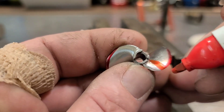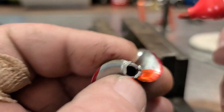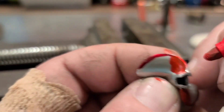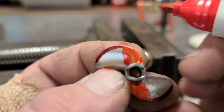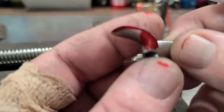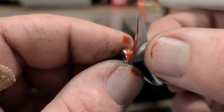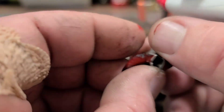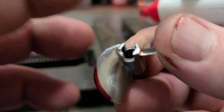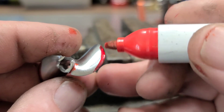Definitely don't want to bend the tongue area — none of that light red area right there. That's your tongue and it's supposed to be the lowest point of pitch on your propeller. You don't want to bend any of this — that will mess up the way the water ramps onto the prop. So we're not going to bend any of that; we're just going to bend the outside edge.